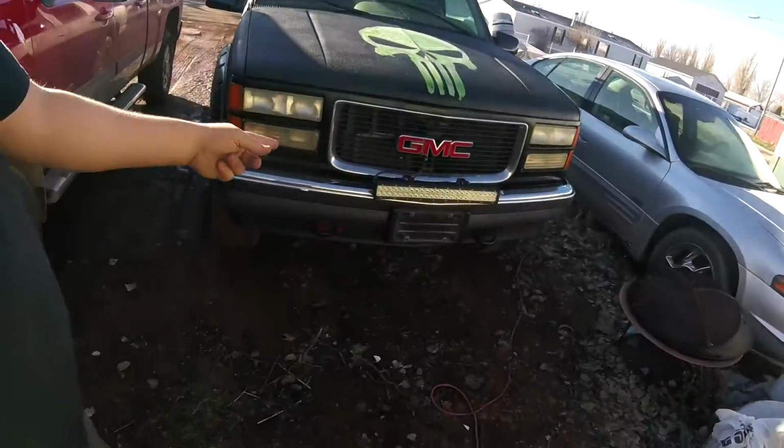I'm going to change the thermostat on it today. That'll probably be today's video, because it just doesn't get hot enough for me. I think that's like a 180 or 175 thermostat. I'm going to put a 195 in it. And the light bar does work. But yeah, that'll probably be today's video. And in the next day or so will probably be the tire video. But I just thought I'd let you guys in on the secret. I will talk to you later.